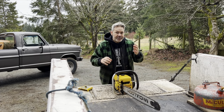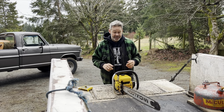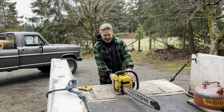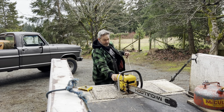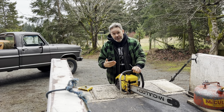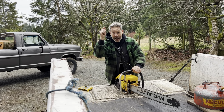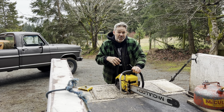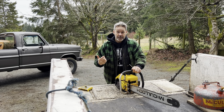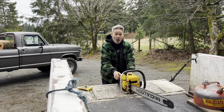I'm going to show you what to listen for. Listen how high these saws will scream. Then what'll happen is it just will not get fuel anymore. Okay? Let's see if we can get this thing to fire. See what I mean? It consumed the fuel in the carburetor, and it probably tried to suck some through the gas tank, up the line, around the corner, and into the carb, and it just didn't do it. It didn't catch. So I could continue to pull, which I could do. Let's put a choke on it, see what happens.